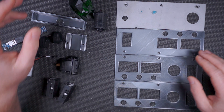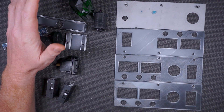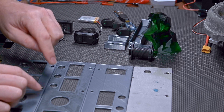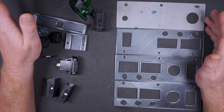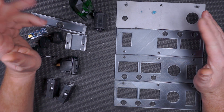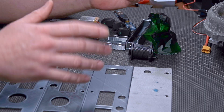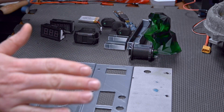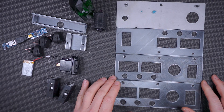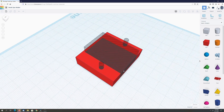So I was turned off from 3D printing a while ago, then turned back onto it. There's another guy who recently did some tests about what plastics would survive in a car in an automotive environment. PLA — the most common filament, what these parts are printed from — doesn't do particularly well. It tends to go a little bit limp around 140 degrees Fahrenheit, roughly 50–60 degrees Celsius. So inside a daily driver parked outside all day in summer with windows up, this would be no good. However, the LTD is a different beast — it's not a commuter car.